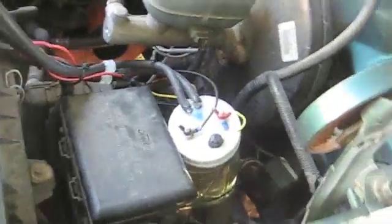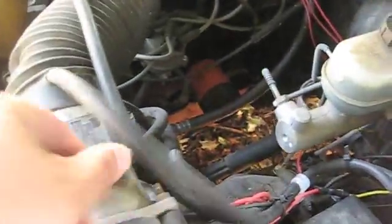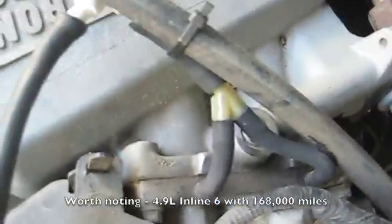So there's the electrolyzer. One vacuum hose goes into the intake — this hose actually runs into the intake tube and ends right before the throttle body right there. It's all the way in there. I did have a fitting right here that it was just plugged into, but running it in seems to work better. The other vacuum hose goes into a T right there, which goes into the intake.